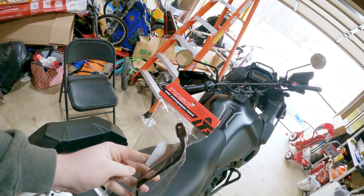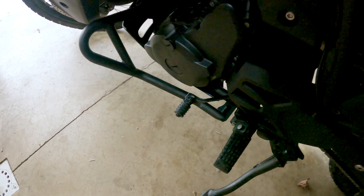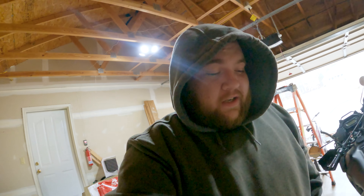It's like 20 bucks. The problem that I have on this motorcycle is down here — the shift lever is super close to the peg. I'm a big guy and I wear a size 13 shoe, so it's a little close. I want to extend it and we're going to do that today. The only tools you're going to need are a 10 millimeter open-ended wrench — just a wrench, really — and some blue Loctite if you have it, just because the KLR is known for vibrating, so it helps keep the bolt in.